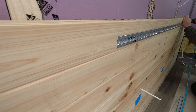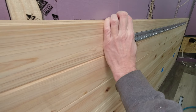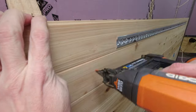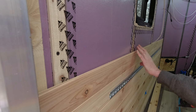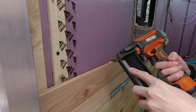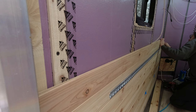The other thing to note is that the cedar really does need a little bit of time to dry. I expected that it came from the factory fully dried, but I noticed that when I left it out in my garage overnight, it did some warping, some cupping. So I gave it a couple more days to acclimate to the temperature and humidity of my garage.